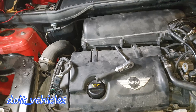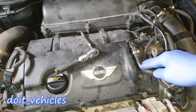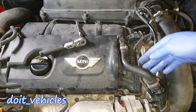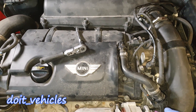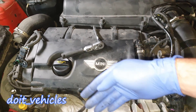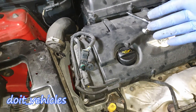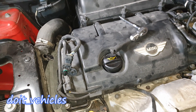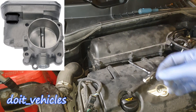It's not going to affect the readings a lot, but they will definitely not be as precise as they should. Some of you ask why there is always oil on this side. As you can see, you've got here the breathing hose which has a connection with the camshaft case, the valve cover case, and oil goes splashing around. Therefore some of the oil will go into this side and be transferred into the intake. If you place too much oil into the engine, this excessive oil will go into the intake and spray around the intake manifold all the way to the throttle body. So it's important to put the exact amount of oil necessary — do not overfill the limit.